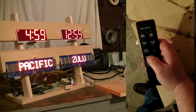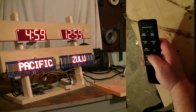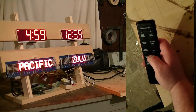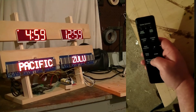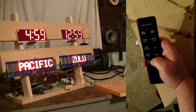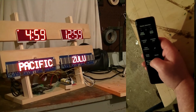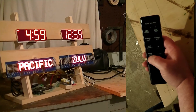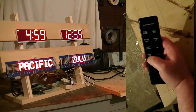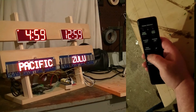I need to go ahead and save this. If I were to unplug the clock right now and plug it back in it would revert to the settings I had saved previously, so I need to save these new settings. On this clock there's only one way to do a save — special mode number 4. Press and hold the mode menu button and eventually it will begin to count — zero, one, two, three, four — very slowly — then I release the button.